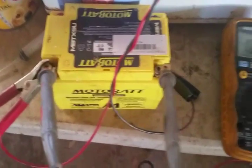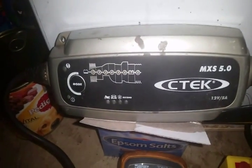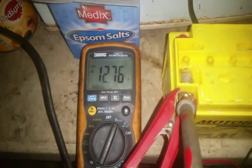What a result! It's been six hours after the last charging. I did two more cycles on the 2.7 amp charger, then threw it on the CTEK 5 amp charger. It's been on there for about two hours and look at the results — it's holding steady at 12.7V. I am absolutely blown away. There was a fair bit of overspill — it bubbled out a lot — but I did have it brimming with water. That's a fantastic result.